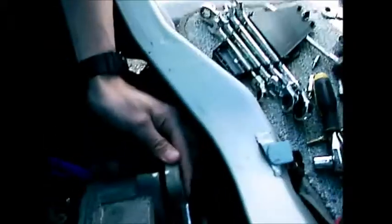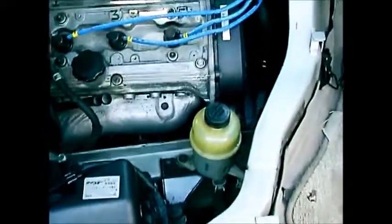That's that bolt out. Now we're going to have fun and games getting that out, so we'll just pause. It just needed a wee bit of persuasion — not much — and out it comes. When putting the distributor back in, remember to make sure it's got a wee bit of grease on it to help it slide in, because if it's dry you won't get it.